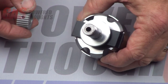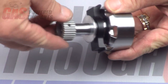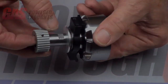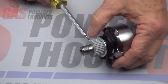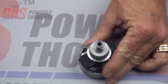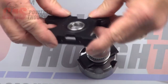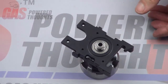Now you want to put the pulley on — it's aluminum and fit really tight on my clutch shaft, so I heated it up in an oven which made it larger. Line up the set screw hole or grub screw hole with the flat on the shaft. Once you get it hot it will drop right on. Use a wrench to tighten the grub screw on the flat and put some thread lock on it. Now put the top flange on the pulley with the shoulder going up. On top of that put the top bearing mount — it's actually the motor plate. Push that down over it and take the retaining nut, put some thread lock on the threads, and tighten it down. Get it good and tight but not so tight it binds things up — everything should still turn freely when done.